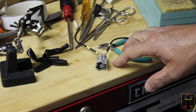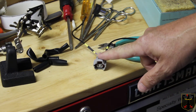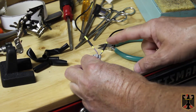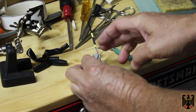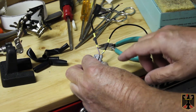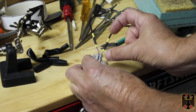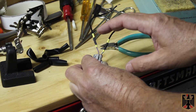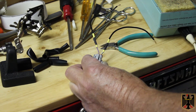Now what we're doing is modifying the wiring loom. On the driver's side of the vehicle we have to extend the three injector plugs by this length right here. I've already soldered the wires — I cut them at different points so that if they were to short out they wouldn't touch each other theoretically. I also double-insulated them with heat shrink: the yellow is one long piece of heat shrink and the black on top is another piece, which should make it very very good.